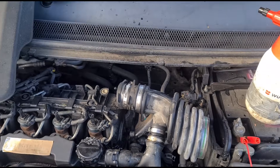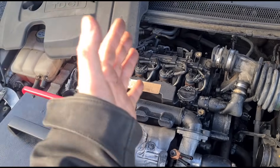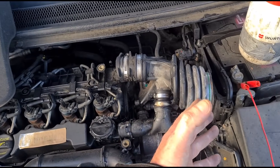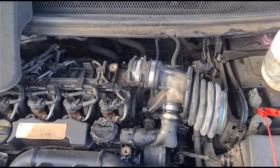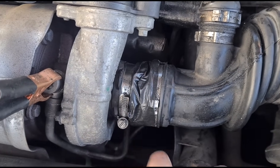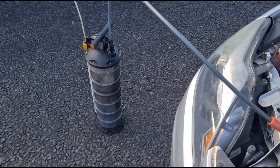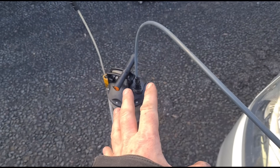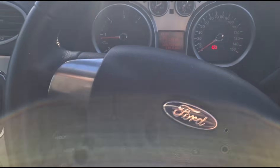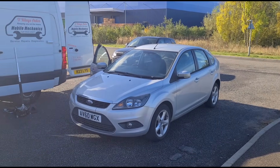Using some brake cleaner to clean up the area and doing something temporary with the split hose so he can get home. He came to me because his own mechanic couldn't diagnose or fix the DPF fault — we've got that sorted. It makes more sense that once he gets back to Skegness, his mechanic replaces the hose, which is a few-minute job. I've removed the jubilee clip, put duct tape across and bridged it, then put the jubilee clips back over — a temporary seal. Wearing my cowboy hat for that one as it's not an official repair! Now draining the oil, doing a quick test drive, rechecking for codes, and that's it — see you on the next video.